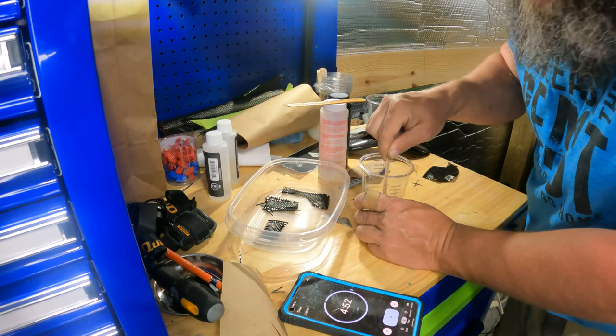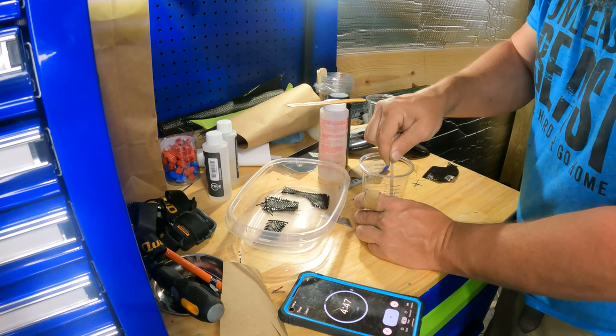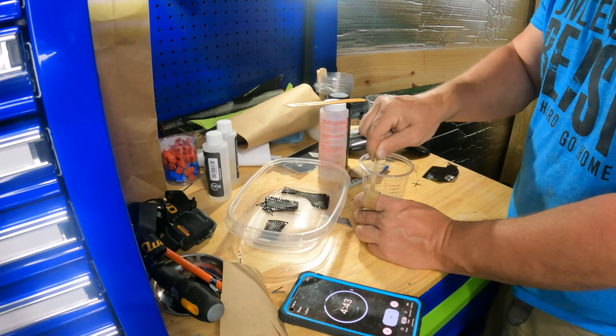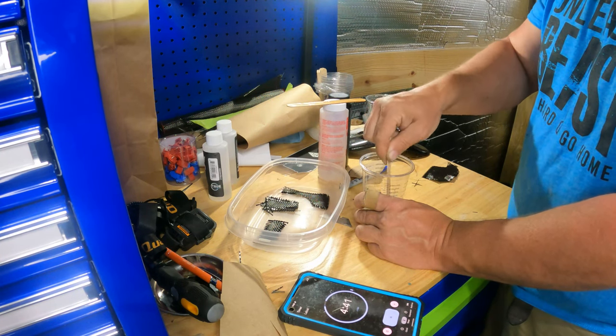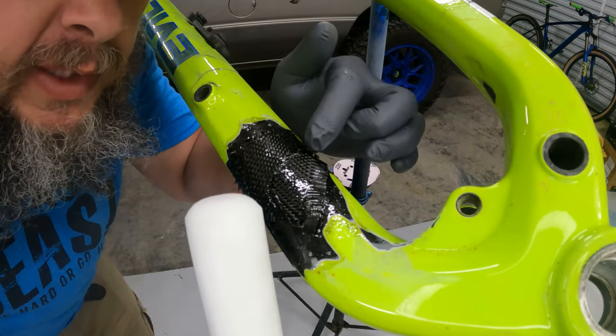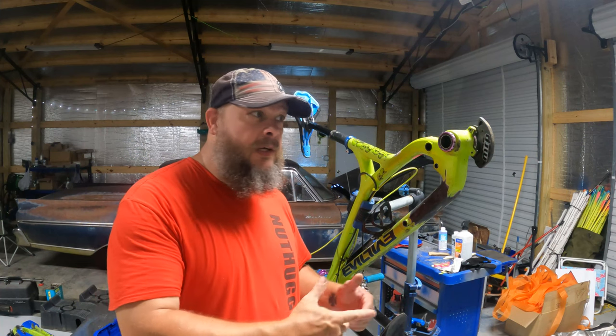You don't want to whip a whole bunch of bubbles in — the less bubbles the better. I put resin on first, then laid my first layer, then my second layer, and now I'm on my third. That's all I got: just a little bit of mixing and a little bit of putting layers on. Most of the footage I lost was of me doing more layers.